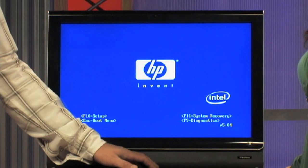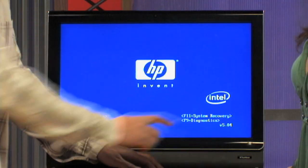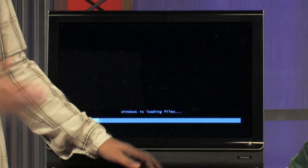Now let's say your computer turns on and you get an image, but it will not launch into your Windows home page — so you can't press Start and you can't do what Malou just showed you. I'm going to restart the computer to pretend like we're turning it on and can't get to where we want to go. So maybe this is what you're seeing: it will turn on, there will be a blue screen that says HP, and it really doesn't do anything else after that. Get your finger ready because you're going to need to press F11 repeatedly once this blue HP sign comes on. Keep pressing F11 — it says right here 'System Recovery.' That's where we want to go. This is if you can't get to system recovery the way Malou showed you because you don't have access to Windows. Again, back up all your files — do not do a system recovery without backing up all your files.